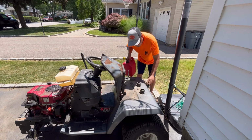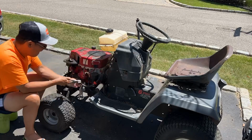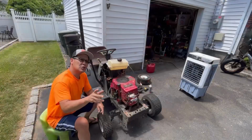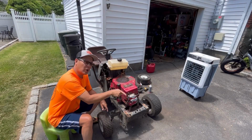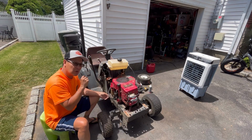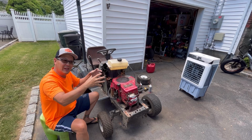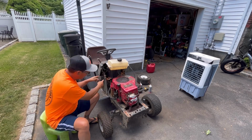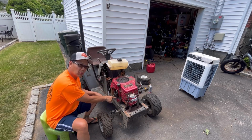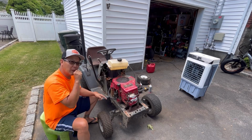I'm going to reconnect the mechanical fuel pump to the carburetor now. So I just reconnected the fuel line to the carburetor that's connected to the mechanical fuel pump. And then to start it off, you take this hose out and you blow into it as hard as you can to inflate the rear gas tank. Kind of pushes out a little in there. And then when it releases, the fuel will suck through here, and then it came out that other end. So now at least your fuel line is primed with some fuel, so less cranking to try to get it into the fuel line. You're just manually priming yourself.